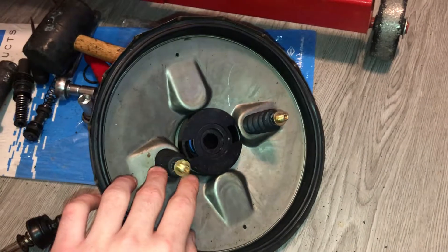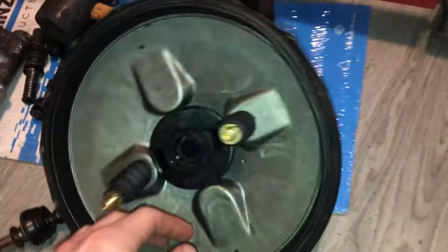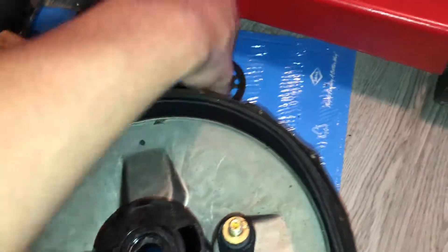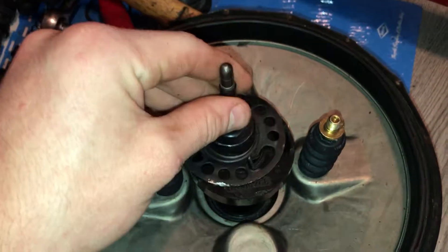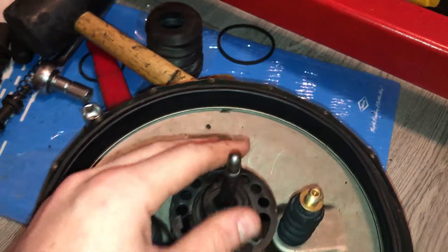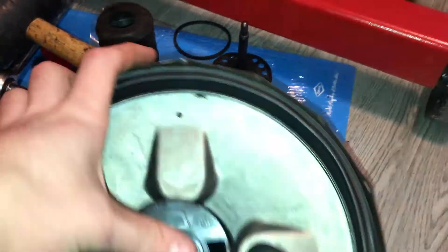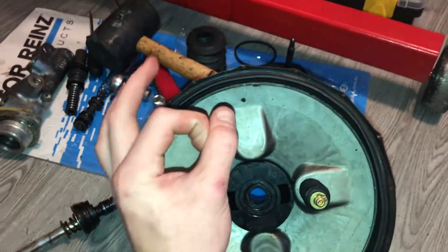This plastic part here — I didn't spend too much time looking at it in my last video, except to remove it. I wanted to draw attention to these two notches in the top. In the video I made last time, there was this kind of shutter wheel that went over the top, and I had a theory that maybe it controlled vacuum flow — like as a factory calibration they could set how aggressive the booster was. Maybe that's right, but the important thing is that this side of the booster is applied to engine vacuum.